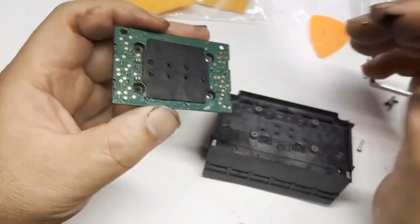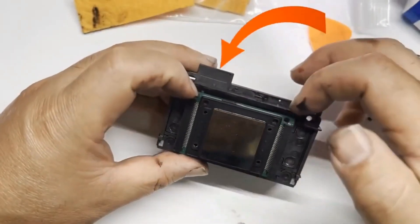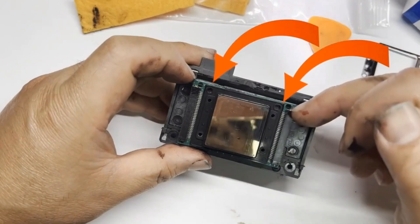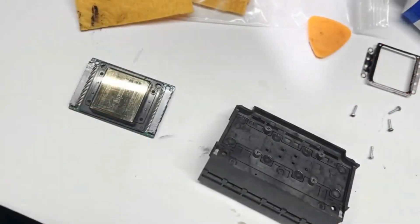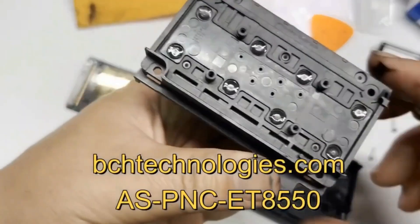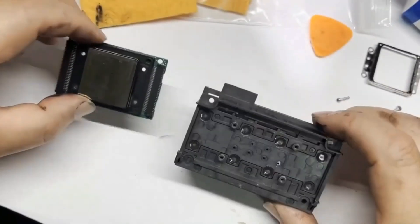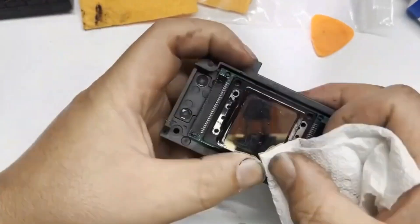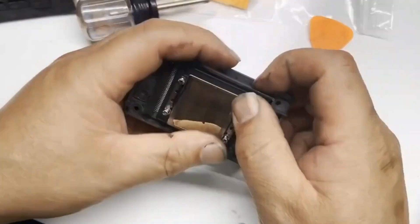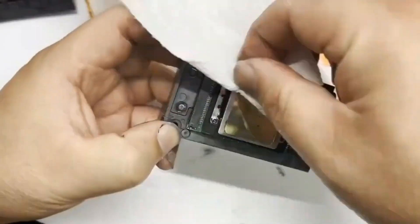This tip is going to save your life. See the base and this tab — on the other side it has a serial number. That goes on the side with two holes on the top, so you don't want to install this upside down. Now it's a new base over new base. We put it aside with the serial tab on the top, with two holes on the top, and put it in. Now we put our four screws in. You want to tighten the two diagonal screws first, then go around tightening each one. Now we're ready to waterproof it.